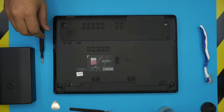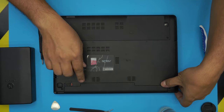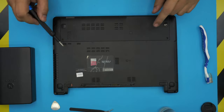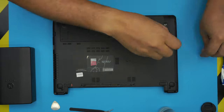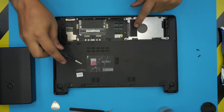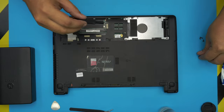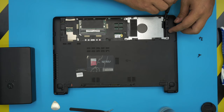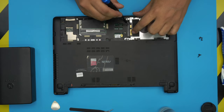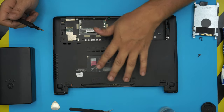With all that on hand, we're going to start the service. First, power off the laptop. We're going to remove the battery by pulling the trigger, holding it, putting it in the lock position, and sliding back the battery. Now we're going to remove the bottom service cover by removing two screws and sliding it towards the front end of the laptop, then lifting it up. Remove the hard drive by removing three screws from the carrier.